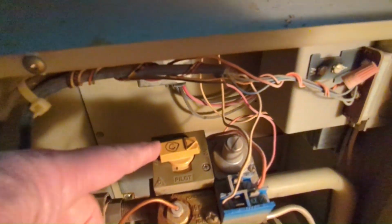So here we are behind the furnace in the corner of the laundry room. And here's the furnace, extra filters. Oh, here's a thing. I do have a problem that occasionally my pilot light goes out. I have a standing pilot light on this furnace, right there. Once in a while that pilot light decides to go out, and I have changed the thermocouple on it a couple of times, but it still likes to go out once in a while. So if somebody else needs to light the furnace when I'm not home, I've put detailed instructions here, step by step, exactly how to do it, and I took a picture of it and stuck it here, and things are labeled. When you want to see what you're after, it's all right here. They can look on the picture when it says look for A or B or whatever. There's A. Oh yeah, there's A. Anyway, it lets people know how to do it if I'm not home.